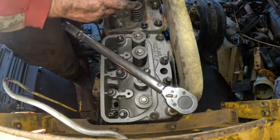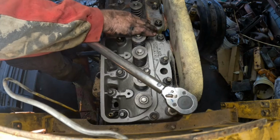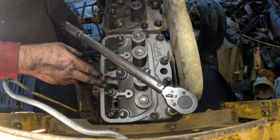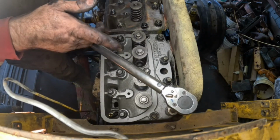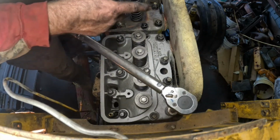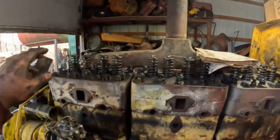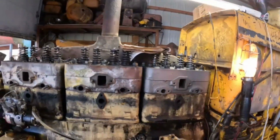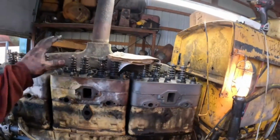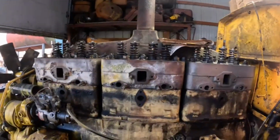Okay, so I'm gonna do the rest again, then I'll come back. I'll probably finish the smaller ones at the 130 to 135 range, but I'm gonna creep up on the big ones. So I'll bring you back when I'm all done. Okay, well, the head's all tightened down for now, or for this round, I should say. Next will be putting the push rods in and the rocker arms and adjusting the valves, but I'm gonna save that for the next video.